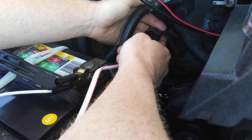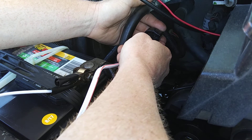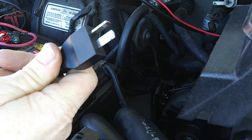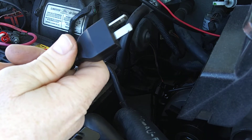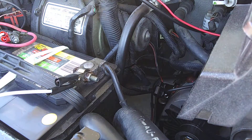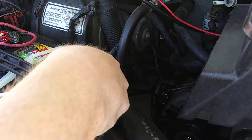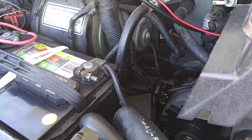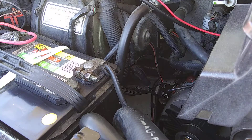I know it's not the motor. The motor ran off the 12-volt battery by me connecting it directly. It runs, but it won't run when you plug it back in. So I don't know what else it could be — whether there's a relay switch or something of that nature that's gone.